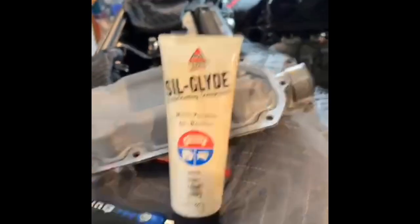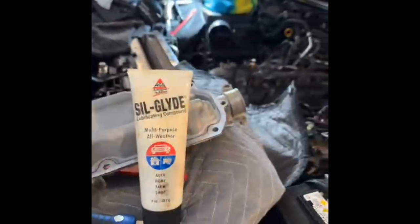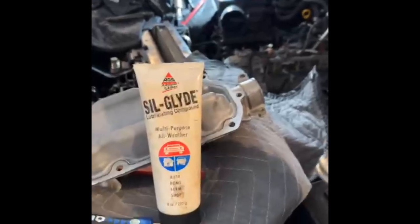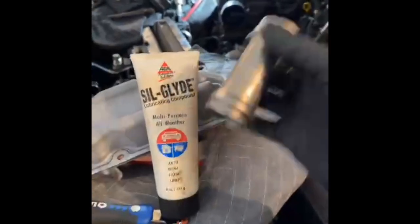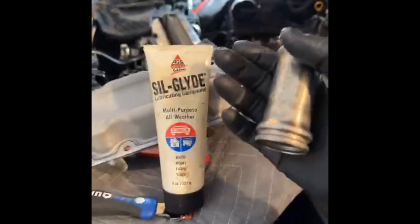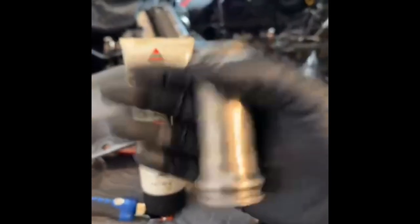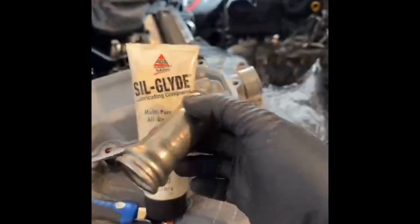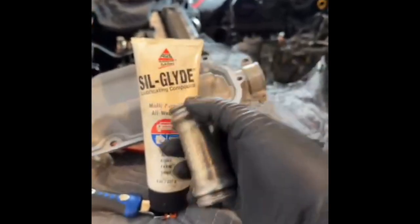Here's a quick story: an engine project at work experienced cooling system O-ring failures after the engine went through production tests — all of the O-rings in the cooling system failed. It turned out the cause was a biodegradable anti-corrosive wash that was vegetable oil-based, used on the engine instead of paint. The natural bio-oils, similar to biodiesel, were reacting with the elastomer of those O-rings, causing them to swell, turn to putty, and all the cooling systems just started puking coolant everywhere. We ended up having to change the O-ring material to one compatible with the vegetable-based wash.